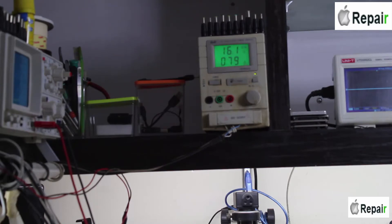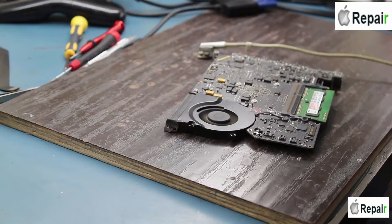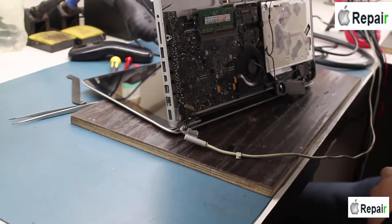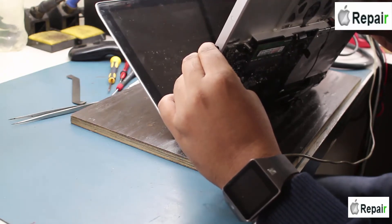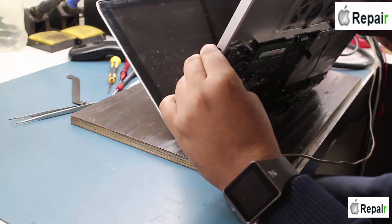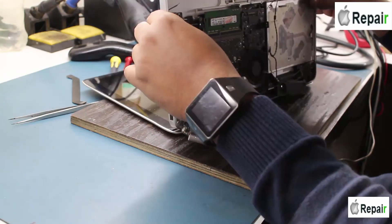This is a very common fault in the MacBook Pro A1278 model. I'll tell you today how you can repair this type of problem. First I have to find out whether the display is coming or not — at least is the display coming and going off, or is there no display at all. I'm using a panel to test it. The fan is spinning and off, spinning and off — no display at all.